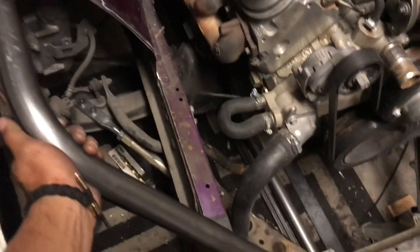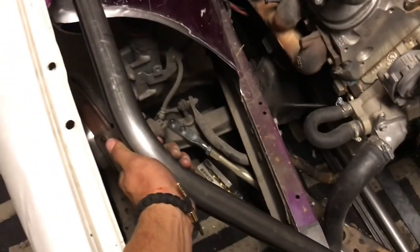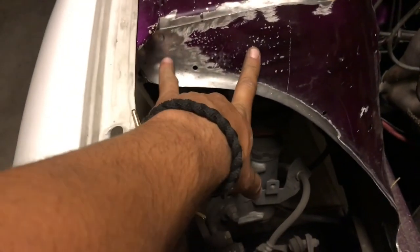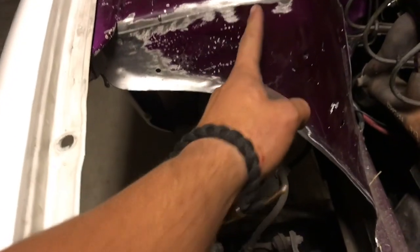I pretty much ended up with this. I did have to shorten it a little bit. I did a 65 degree bend, but I'm going to have to notch it at the bottom so it sits flush with the plate right here. So now what's next is I'm going to have to drill out the holes so the nuts on the back of the plate can go through the strut tower and then I'm going to weld it on here.